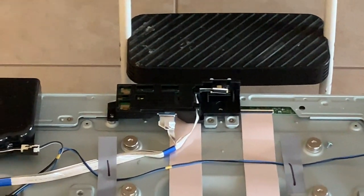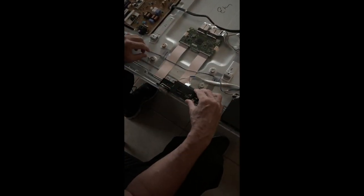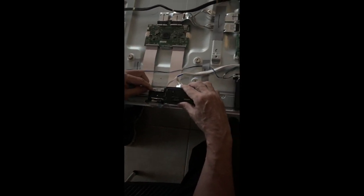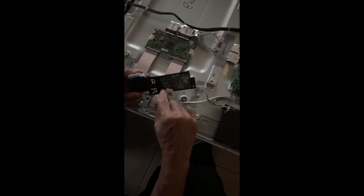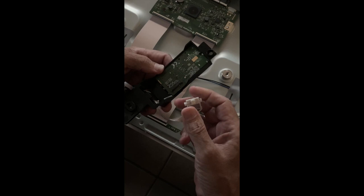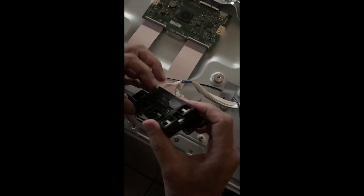I'm going to pull that out and replace it. This screw right here takes off this piece, which also has the manual operation button for the remote. If you turn it over, this is actually the Wi-Fi card right here. I'm going to press on the clip so the connector comes off, and there are two press clips down there. I'll take a wide-tip screwdriver and press it in to pop the card out — like so. And out pops the card.